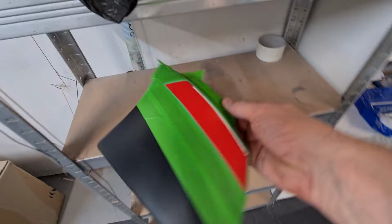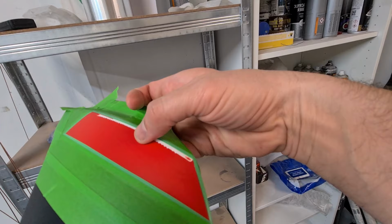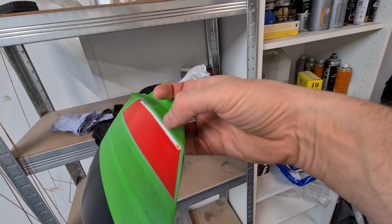Might have to come back to that because we're hitting a deadline now and this needs finishing. I've got another problem here. As you can see there, I've masked this up ready to be painted tonight. This was the winglet. And can you see all those little saw blade effect things? That's what happened to this decal. I barely only put one little tack coat on there, and it did that straight away, reacted to the paint, so I've had to sand that right down. I'm going to have to repaint that before I clear it. And that's about it. So I've got some more stuff to do.